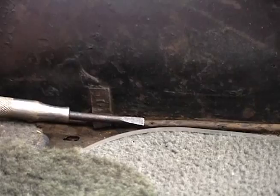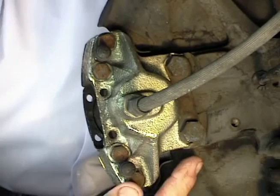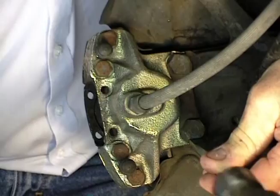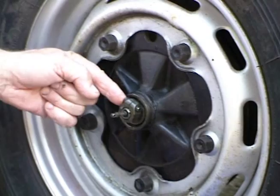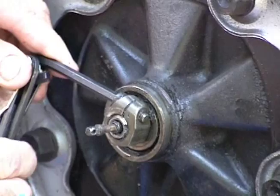You can see the caliper's held on by two bolts right here with 17mm heads on them. They have a little locking tab that has to be bent down so you can get that out of there. When we get in here you can see there's a completely different arrangement. There's a little pinch nut that goes on here and it has a socket head screw — a 6mm Allen type socket right there. So you can take your 6mm Allen wrench, and then we'll put our drum in some mineral spirits and clean that all out real good.